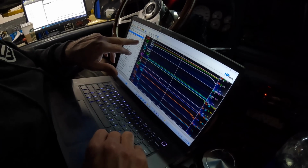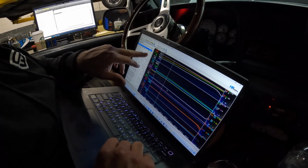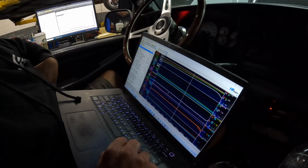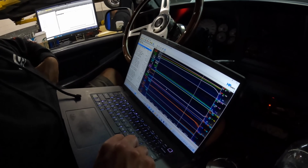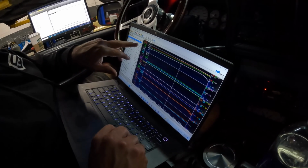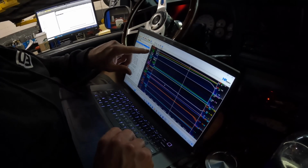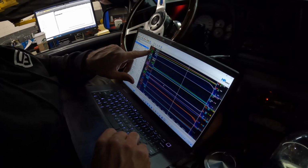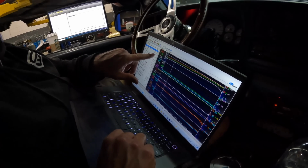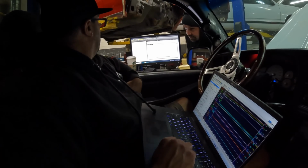But here, if you look at it here, here's the torque converter slip. About 800 RPMs of converter slip, 890, 920, 880. Oh yeah. So it definitely seems like maybe the converter is slipping. Here's the trans input shaft RPM, 4,100. That's how fast the input shaft of the transmission is spinning. And the engine's going 5,100. So it's 1,000 behind. Yeah. 822, 887, 920. So it looks like maybe the converter is unlocking.